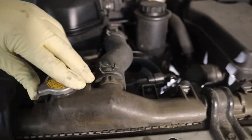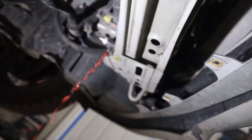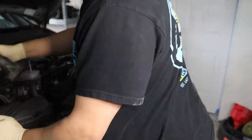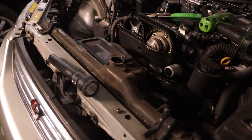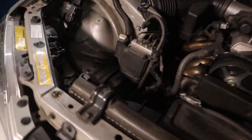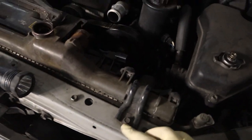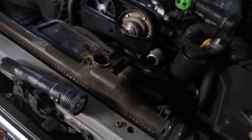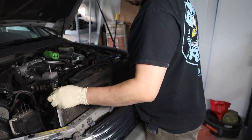Make sure your radiator cap is off — it'll help it drain faster. Looks like I need a new radiator cap. Up top, all we need to remove the radiator is to take the air box out, which makes it a lot easier. These two are the mounts for it — just take those out with two 10mm bolts — and then these two fan connectors along with the upper radiator hose, that's pretty much it. Once I get those out and the lower radiator hose off, I'll be able to just pull this straight up.